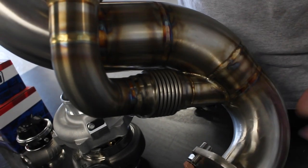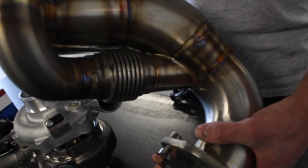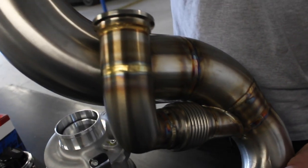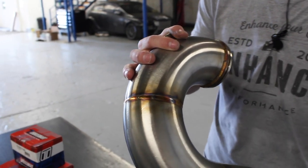Tying it back in means absolutely no hassle at MOT time. Screamer pipes are nice, they're loud and fun, but they do tend to get annoying over time. You can't turn off a screamer pipe, so every time you put your foot down and the wastegate opens later in the rev range you'll get gas out the screamer pipe — it makes the underside of the car messy and it's illegal. So wherever possible with these kits we try to talk people into a recirculated downpipe.